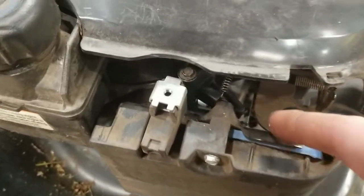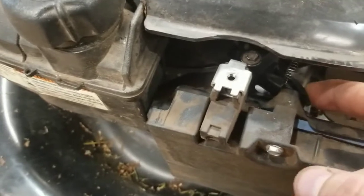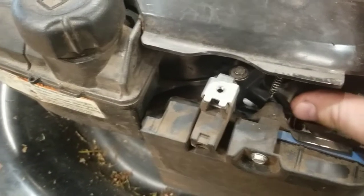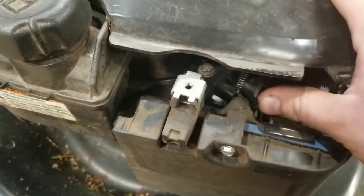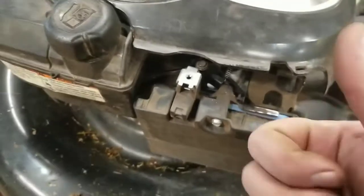I just went out and used the lawnmower for a while. As you can see, the spring is stretched way out and I can't even push the choke closed — that thermostat works with a lot of force. Because the choke's all the way open I can tell that my thermostat is good and working properly. This is a 100% repair.